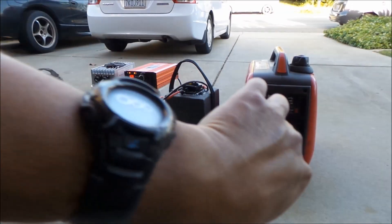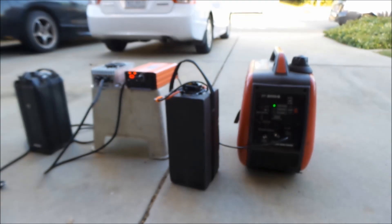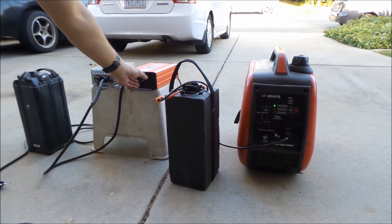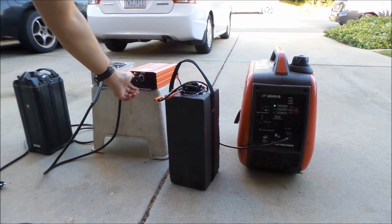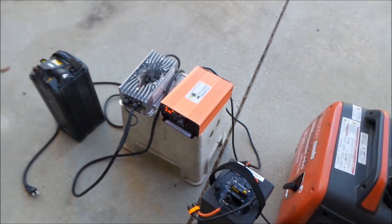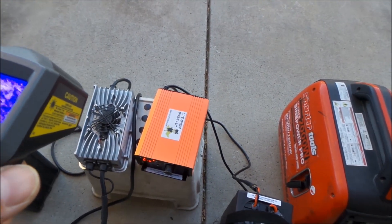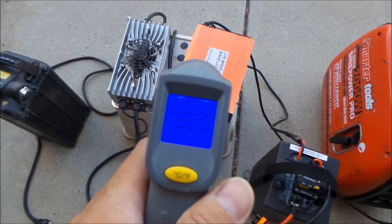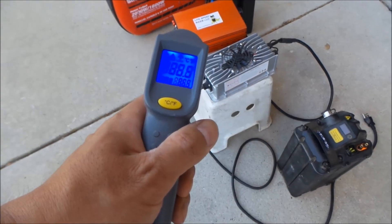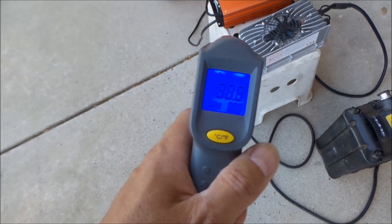It's been about 5 minutes and 30 seconds and it's still charging — really loud right now. We're going to turn the current all the way down. It sounds totally different charging at 1 amp compared to 12 amps. Just in case you're wondering what kind of heat this puts off when charging, the case is putting off about 95 degrees. It gets warmer on the right side, so if you've got an external fan, it's probably a good idea to hook it up.